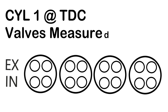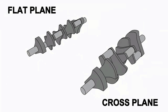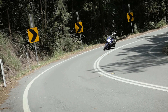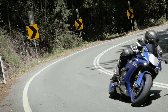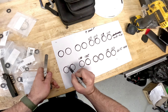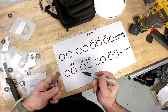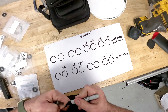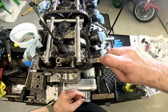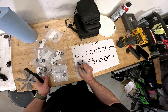The factory service manual is showing me which valves to check. Most motorcycle engines out there are what's called flat plane crankshafts, so unless you have a Yamaha R1, the process is going to look just like this. Be sure to reference your bike's service manual to confirm which valves you should be checking and in which order. I need to check and write down the clearances measured on the valves. I'm using a couple of sets of feeler gauges depending on the gap that I need. You may also need to combine more than one feeler gauge blade to get the most accurate reading. The measurement should be within a couple hundredths of a millimeter, so take your time and double check.